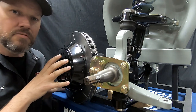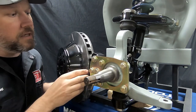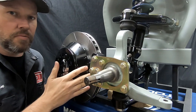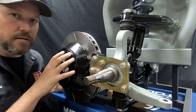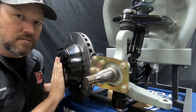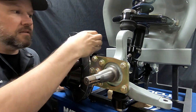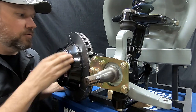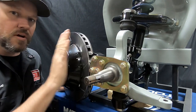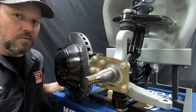Now let's talk about the brake rotor. It's 13 inches in diameter by one and a quarter thick — a really big, thick air gap that gets a lot of air flowing through so you don't fry your brake fluid. It's a US cast finish machined brake rotor on an aluminum hat. The aluminum hat saves a bunch of weight and also allows us to change what's called the hat depth — that's the distance from the wheel mounting face back to the outboard pad face. By varying this, we can place the caliper laterally where we want it. With such a large deep hat, it pushes the caliper in far enough that you can practically run a wheel that is flat on the inboard side and it will still clear the caliper.